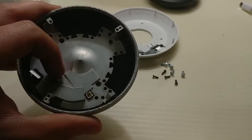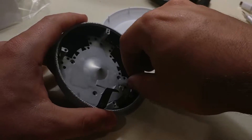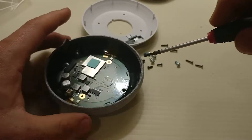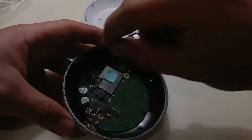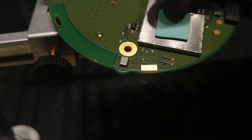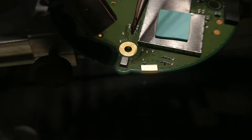We've got to take out the circuit board under here. Got all the screws loose. Now we just gently pull up — there we go. We're going to want to get this circuit board out. Just pry it up. You don't really want to be pulling on this cable here — you don't pull a dog by its tail because it's going to bite you. Pull this by its tail and it's going to rip on you. We're going to be desoldering the microphone there and there. Those are gone. We're going to get the hot air going and slide that microphone right off.